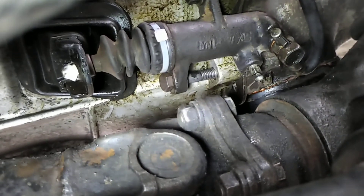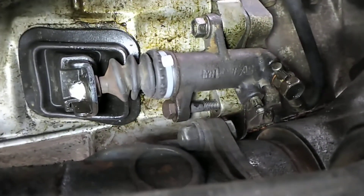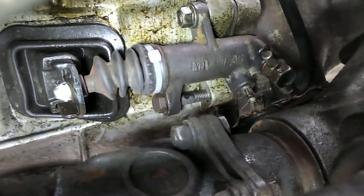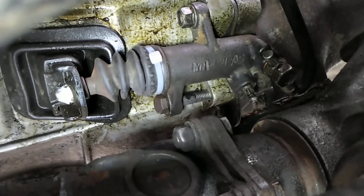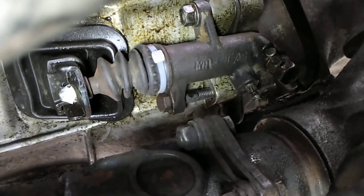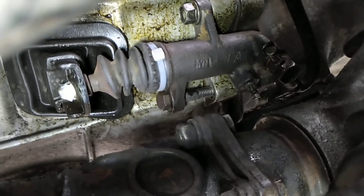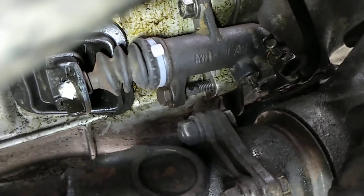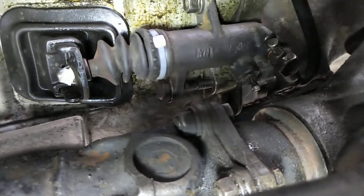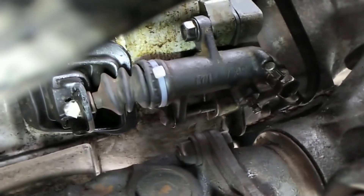So what I've done is I've taken a bolt that's a little bit longer than the actual mounting bolt — coarse thread — and jammed it in the hole on an angle while I had the top bolt about a half inch loose, just to give me some room to move the slave cylinder around. Those teeth are basically biting into the side of the transmission — biting into some aluminum that doesn't have threads — but that's no big deal because the threads for that bolt are actually in the cast iron block on the other side. So I'm chewing up the side of that hole a little bit, but it's on the inside, nobody's ever going to see it, and it doesn't make any functional difference.